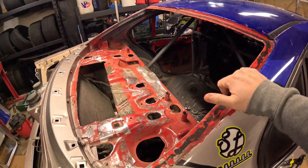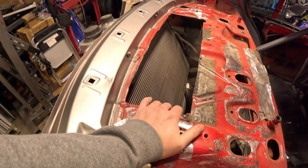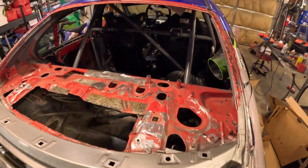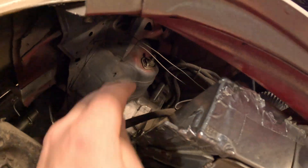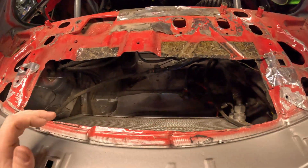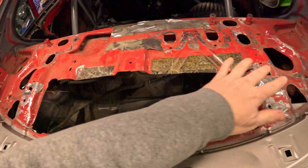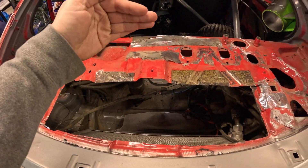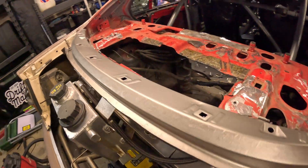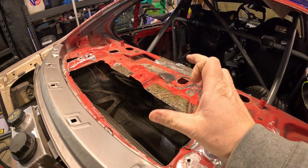The glass is out. Looking at the upper deck lid panel, I've cut the hole for the inlet — the inlet was right there, going through a hole in the center and feeding basically the trunk area. I had to have all this ducting and it didn't work out as good as I hoped. The idea now is to make a plate to cover up all this and then make a duct that'll come up so whenever the plexiglass is here it'll be covered, with just a little slit in it.